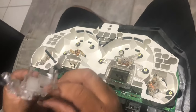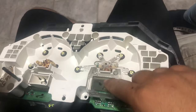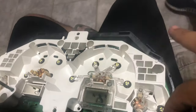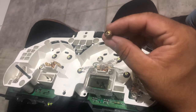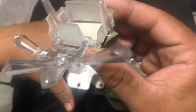So I wanted to make sure I get this on video. Around the gauge cluster, when you have the facing off, in order to get access to and remove the orange film, you actually need to remove a bunch of bolts around it. They're like a golden color - I actually have one right here so you can see them. I think it's around six to eight of them. Once you do that, you're gonna be able to remove this whole piece of the gauge cluster right here.